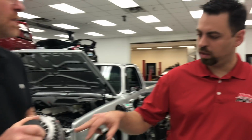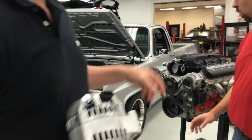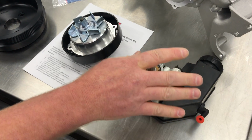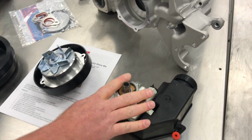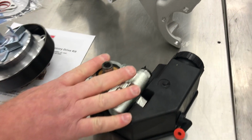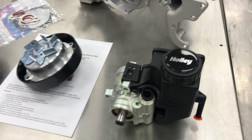One of the unique things about this is also where this post exits to work with this kit, right? Yes. Let's get to that on the swap features in a minute, though. Okay, if that's okay. Fine. Okay, we got our power steering pump. This is the standard Type 2 that all the aftermarket's used to. It's a good solid piece. It also tolerates good RPMs very well. And an integrated reservoir with baffles inside of it, a baffled system there.